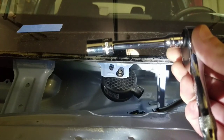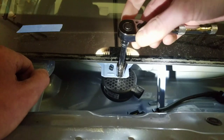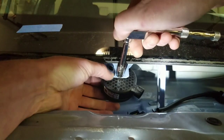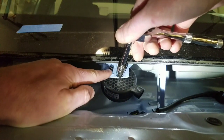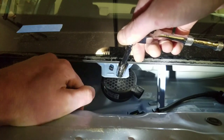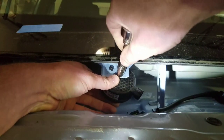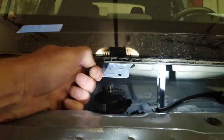I got my 10mm set up here. Just as I thought, it does clear - I'm just not gonna put pressure up that way because I don't wanna crack my windshield. And when you put this back in, you can't mess it up because there's a tab right here for indication on how you put this in - you'll see that when I pull this out. Let's get this nut off - okay, that's dropped. Let's get that nut off.